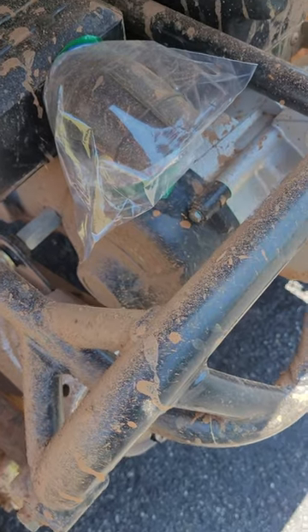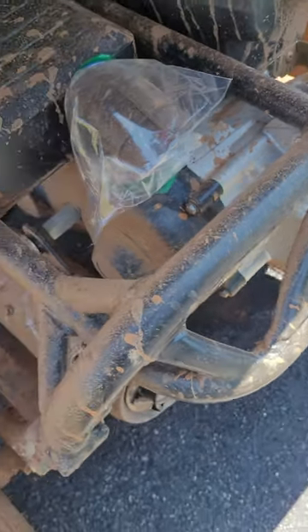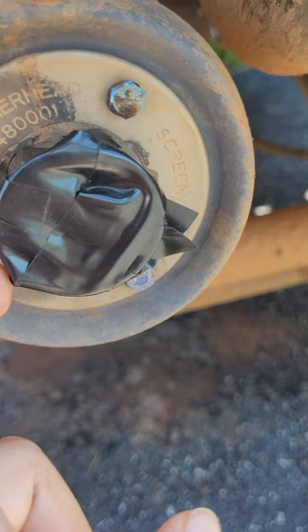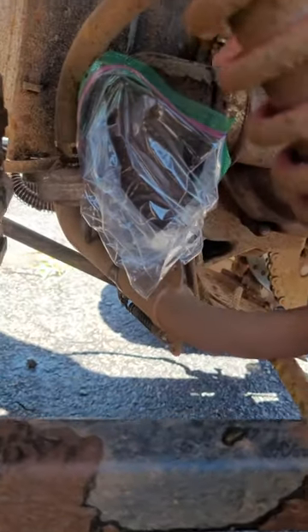This is how to clean your go-kart. First, cover up all the holes on your go-kart so that there's no water getting inside the engine when you're cleaning it. I did this by putting a plastic bag over the intake and electrical tape over the exhaust. I also found other holes to cover up and put plastic bags and tape over them as well.